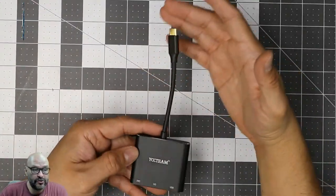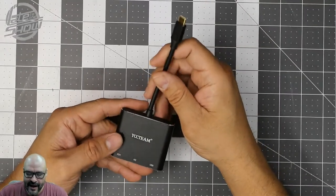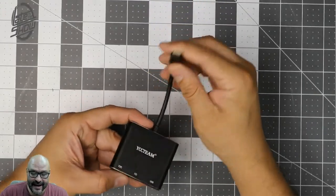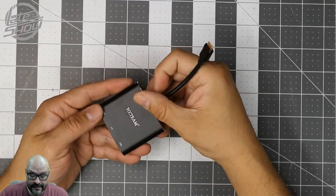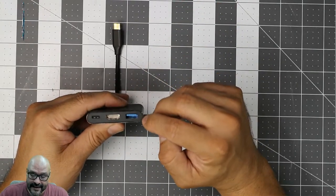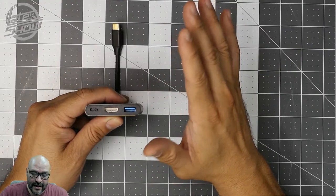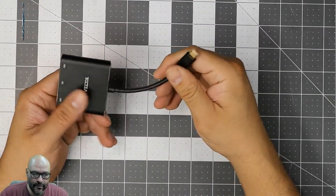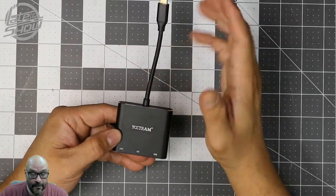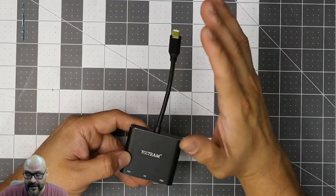So this is a great adapter for those with multiple rooms who want to play their Switch — use the cradle in one room, use this in another. What I really like is that it's versatile — it works on pretty much any device with a Type-C connection. You can power through the Type-C port and display through HDMI, and the USB handles your keyboard or mouse. Just be aware that many first-generation Type-C devices may not be compatible — it's more likely to work with second-generation and newer.